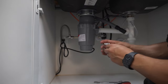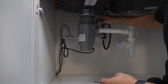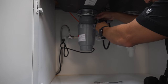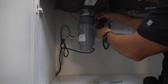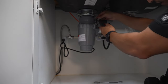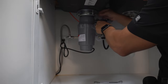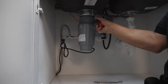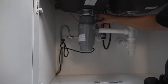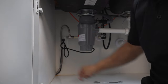Locate your drain clamp and get it added to the drain hose, then position the hose into the drain connection. Depending on the clamp style, you can use a flathead or socket — tighten it down as much as it'll go. Unlike the supply line, you can really crank down on the drain clamp. So we've got everything connected: drain hose, power plugged in, and water supply secured.